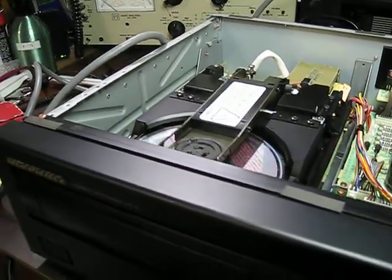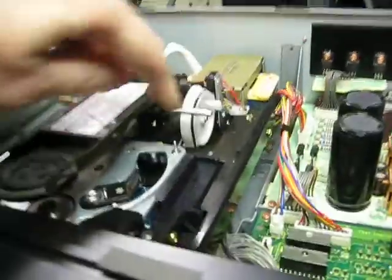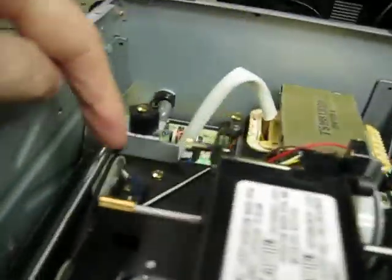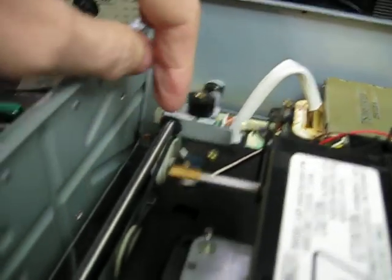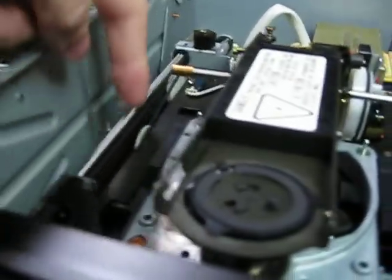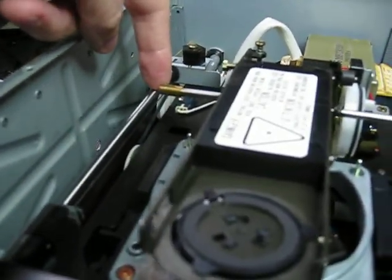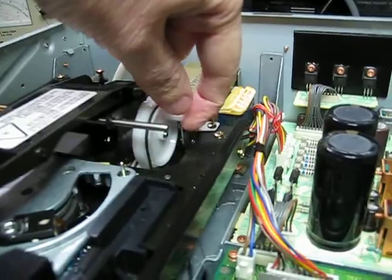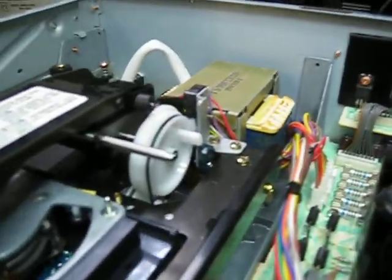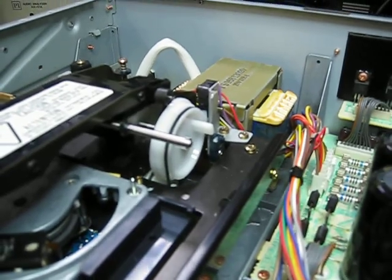So what's the problem? Well, he broke one of those micro switches. You see, the one here has a lever — a little white thing that you can engage and disengage when the mechanism comes in. The tray comes in, engages it, and when it comes to rest in its place, it tells the unit that all is good. Well, that's broken. So that's the start.